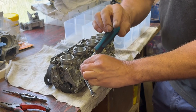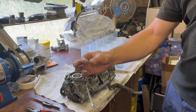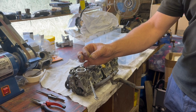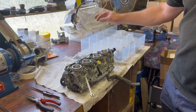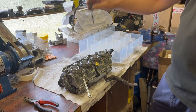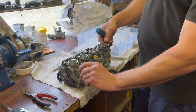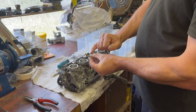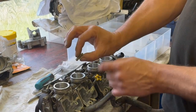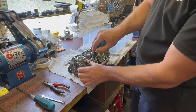There we go — that's the main jet. You should be able to see through that very easily; it should have a fair decent sized hole. If you can't see through it, it needs cleaning — though we're going to clean it anyway. So that's your main jet. It's number one, two, three, four. And then your emulsion tube — undo it and you'll have a series of holes up the side: two there, five there, two there, five there. You need to be able to see through the middle of that one as well.